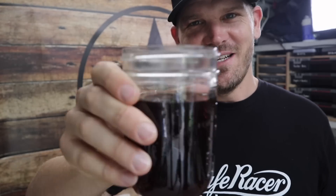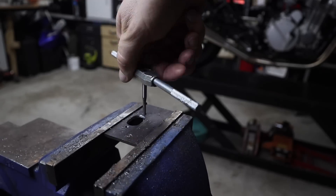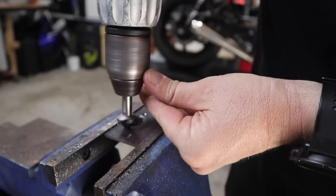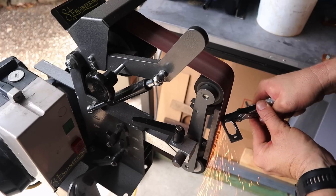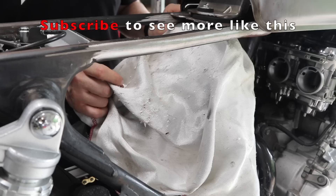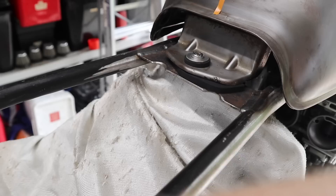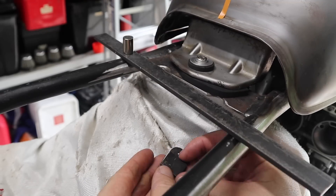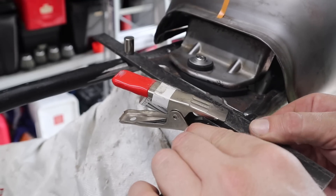Well, it's that time of day — it's coffee time. Cheers. So this is 3mm thick steel and I'm just tapping a thread through it so I can put bolts straight through without needing a nut underneath. Generally after tapping a hole I'll run the countersink on both sides if I can get to both sides. The best thing to protect everything when welding is usually a big piece of leather, but a fire blanket doubled up adds some protection — though things will burn through if you're not careful. To get this in the perfect location, I'm using a piece of flat bar straight across the frame with a spacer between the new bracket I'm welding on and the flat bar.